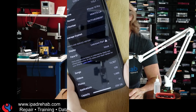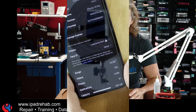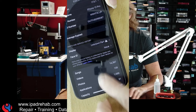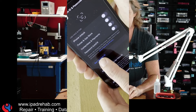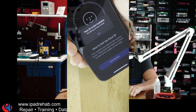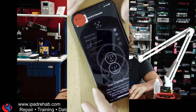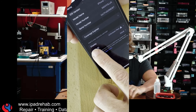We'll tuck in the front so the Face ID cameras can shine through. We're expecting that a phone on iOS 17.5 will notice it has a different screen. Let's go try to set up Face ID. And there it says Face ID not available. What happens if we update Greg's phone to iOS 18? But before we do that, let's check — it says Display Unknown Part. There is our unknown part message.